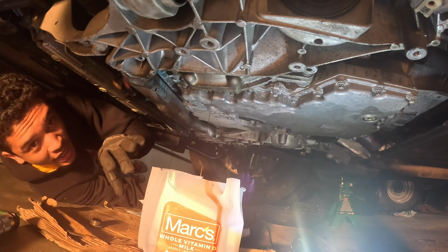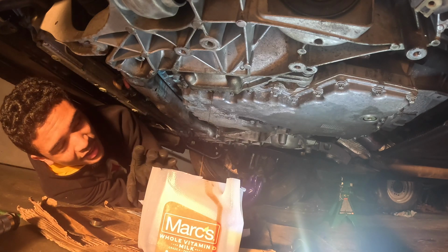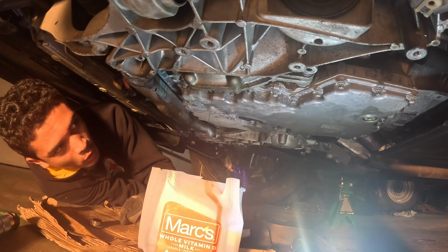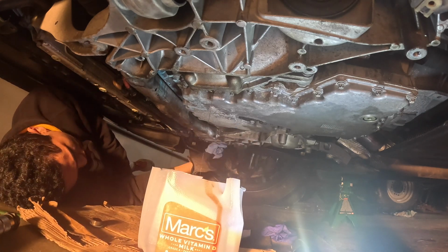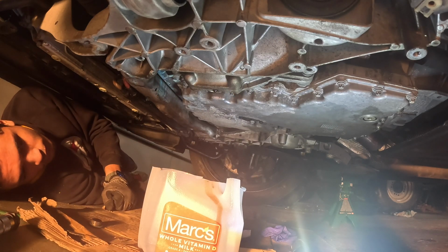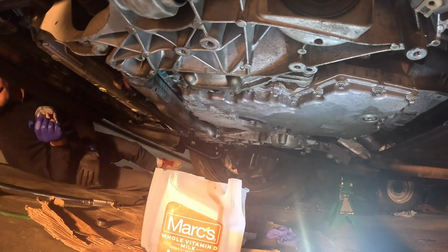And yeah, if you could see in this milk carton, it might be hard to see, but not as much fluid coming out. Just shows you how much we lost in that axle swap. So, all right, as I'm letting the fluid drain here, now is a good time to go ahead, get your new fluid ready and get your syringe ready, as you're going to need to start filling up the diff once we put the drain plug back on.